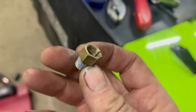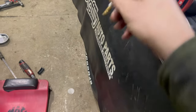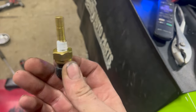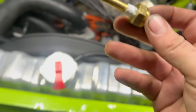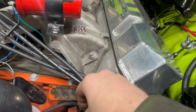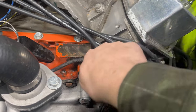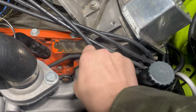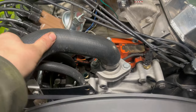This is a pipe extender adapter, probably because this sensor is kind of long and could bottom out in certain places. It actually doesn't in this housing, but the hex just starts to touch by the time it gets tight. I taped the crap out of it, I'm going to snug it down, and hopefully that's all right for now — but it might need a new fitting later. It passes the squish test.